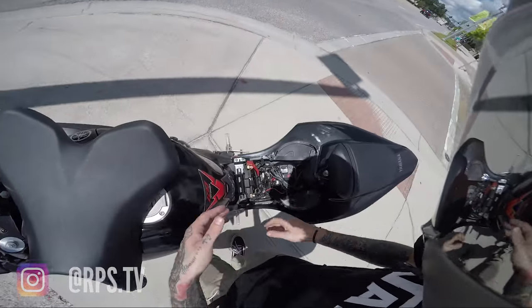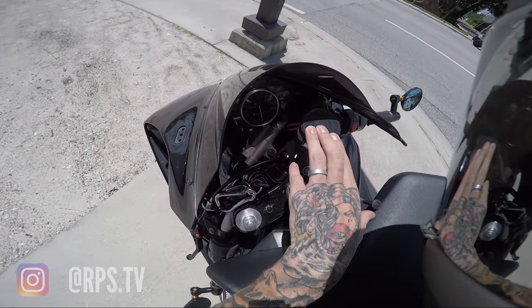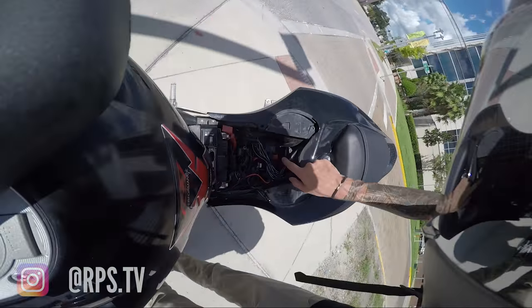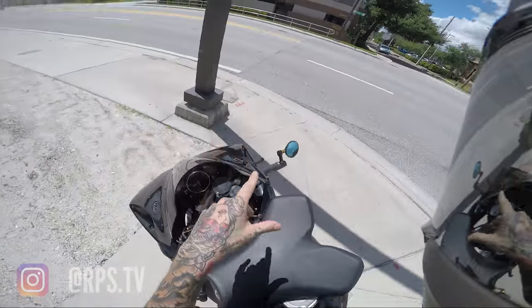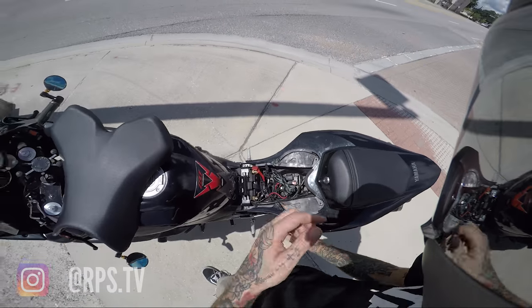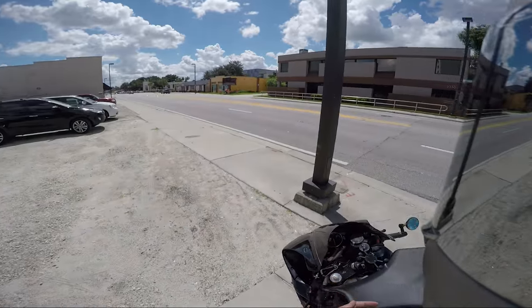D08 at 0.6 is well within the correct parameters — it's supposed to be between about 0.4 and 1.2, so it should be totally fine. It's sitting correctly, but unfortunately it's having an error somewhere else in my system. I'll flick this and you can see it change over here — you can see that blip when I flick the sensor, because it's on a rubber mount and moves pretty easily. So you can see that's working fine.